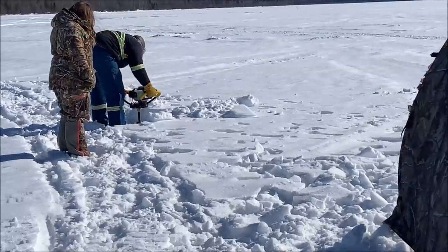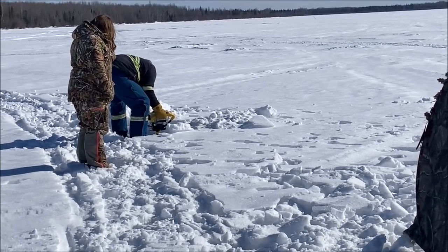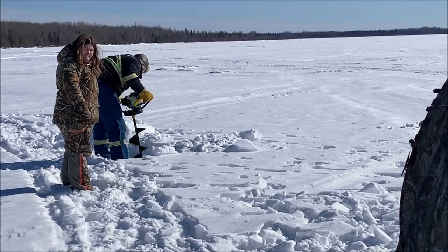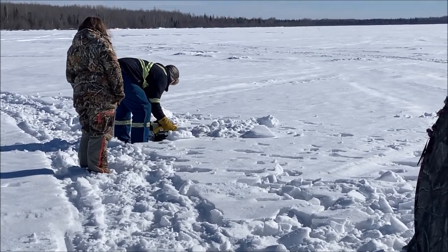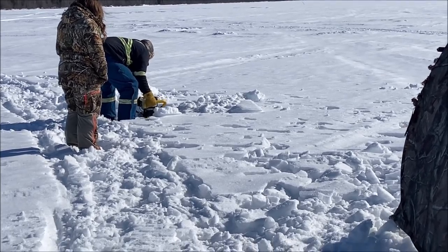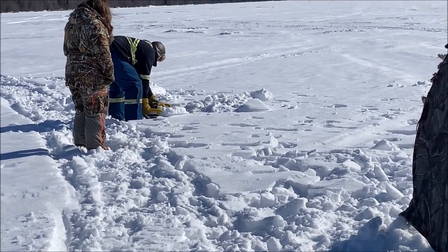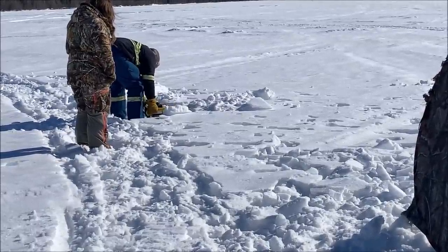Don't seem like she's working right. Throttle's creeping up on her. Old Jiffy augers ain't what they used to be. More plastic on them than anything else. Everything made to throw away. The gas is leaking out through the tank where the line goes through. You can see the rubber gasket there, dry rot a bit. The gearbox is leaking there a bit, so tighten that up. It's only been used a couple times. She's turning slow because she had to turn all that water flush.